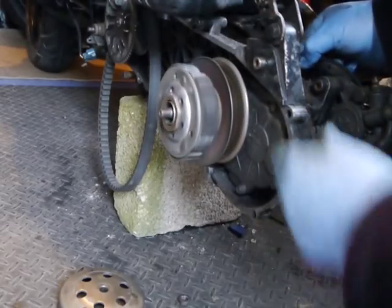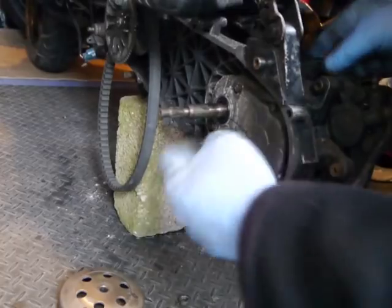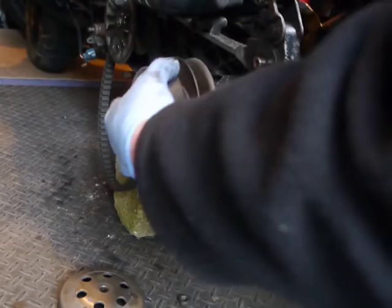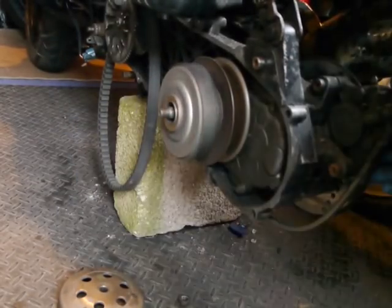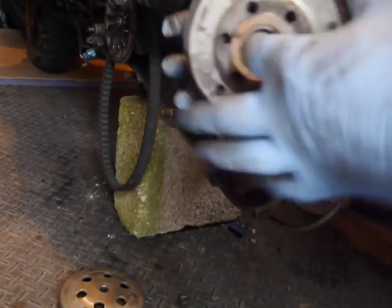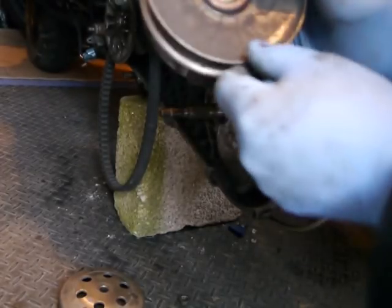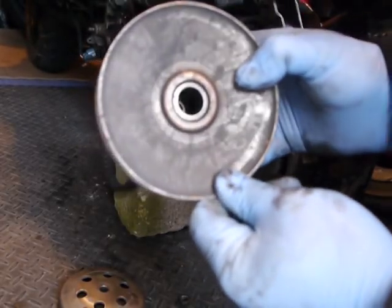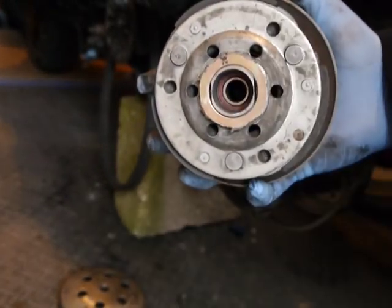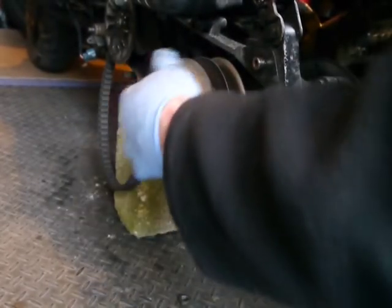And there we go. Take it off. The gearbox is good — at least that's something. It's the clutch. That's not good. I think that's not salvageable. I think it's the bearings in here. I could try greasing them up, but I'm guessing that inside there is pretty knackered. Shame, because it's got good pads on it. All that worked fine — it was just this.